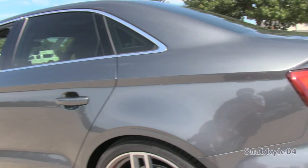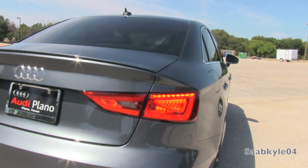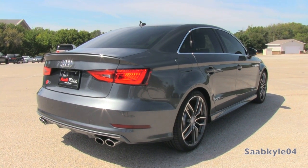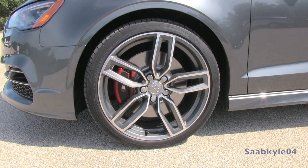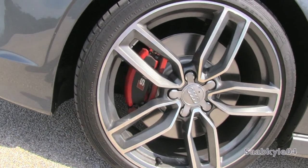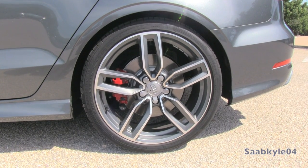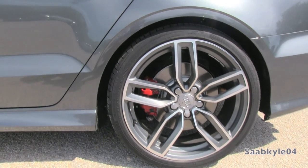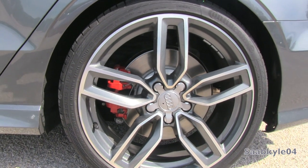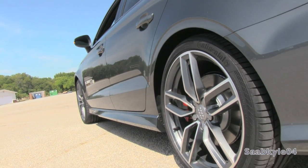A subtle deck-lid spoiler adds an additional sportive touch. The new A3 is an attractive car, almost reminiscent of a shrunken A4. The angular front and rear lights work well with the car's proportions, while dramatic body creases give it a sense of motion and performance. It could still be described as relatively understated, but definitely modern and fresh. The S3 carries two different alloy wheel options — the standard 18-inch, or the upgraded 19x7.5-inch twin five-spoke wheels on this car, wrapped in 235/35 Continental Conti Sport Contact summer performance tires. The S3 carries four-wheel internally ventilated discs measuring 13.4 inches in front with two-piston fixed calipers and 12.4 inches in the rear with single-piston sliding calipers, likely able to stop the car from 60 mph in just over 100 feet.